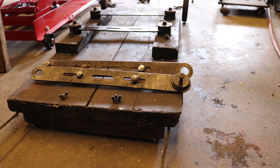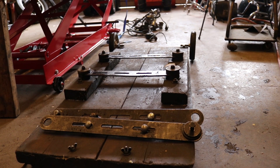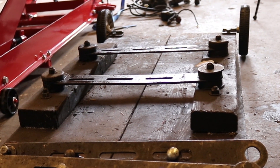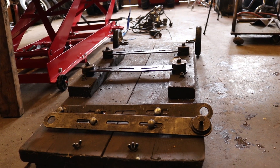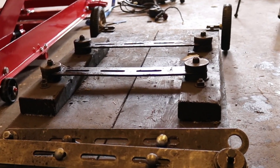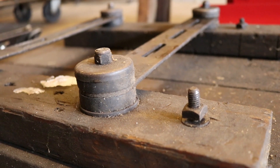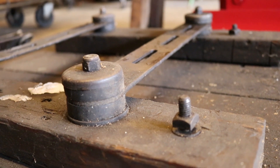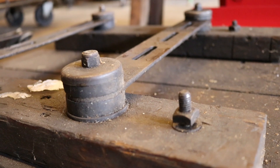What we've got here is another invention of my father's — it is an engine stand. The concept is that you strap the engine down onto these metal bars here. This is mainly designed for engines that bolt straight down onto a frame. This isn't going to work exactly for our engine because the bolts are on the side. The advantage of strapping it down to this is that it has these rubber grommets here — the bar is sandwiched between two pieces of rubber, which helps with vibrations so that when the engine gets running, it doesn't vibrate all over the place.